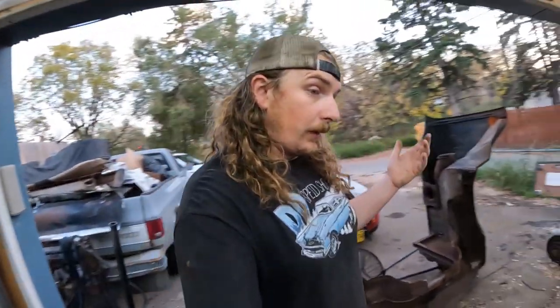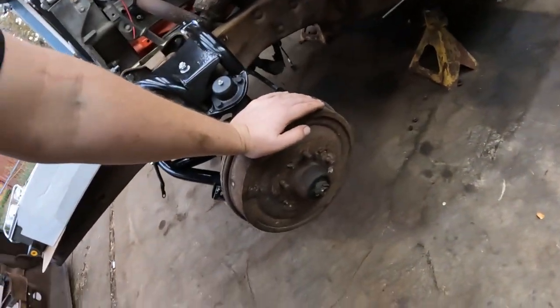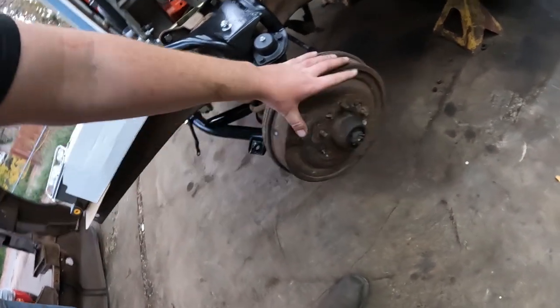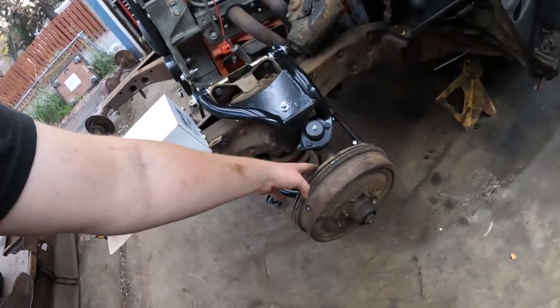Unfortunately, we don't have disc brakes. So doing a disc brake video without disc brakes is a little funny to get started, but that's the way we're going to go. We're going to put the master on. We're going to take this whole mess off. On these things, it's actually pretty simple. You take off this one nut, the whole mess and the hub comes off. And on the back side, there's four bolts. I'll show you that hold on the backing plate.